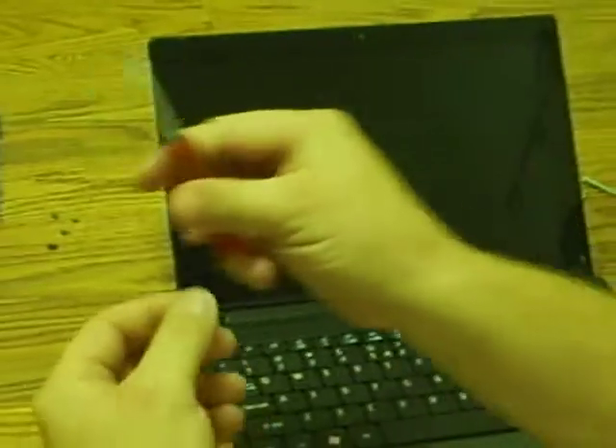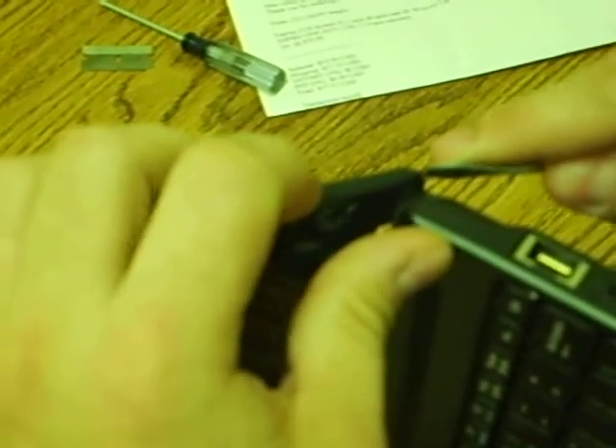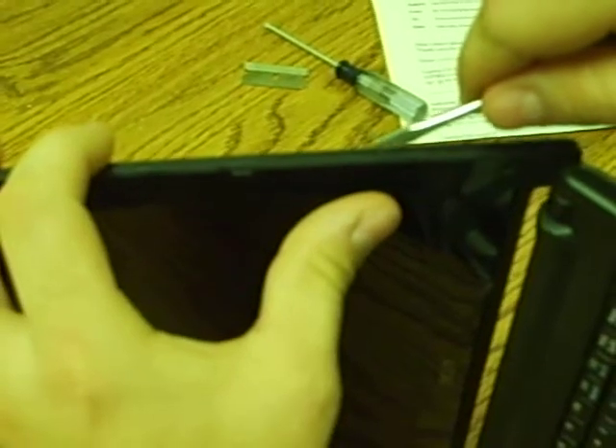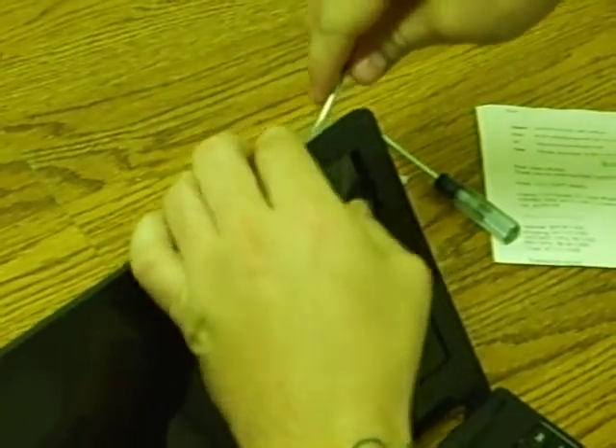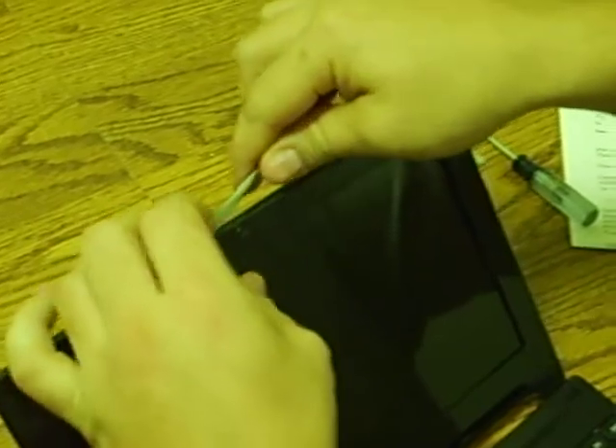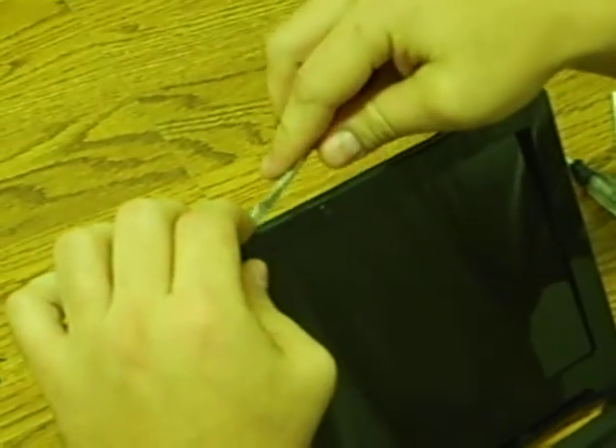There's those two black tape pieces and your two screws. Once you get those screws out, come along with a flat blade and come in the side here. Use the bottom so you don't get too many marks, and just slowly pry up on it. It should come off nice and easy — don't want to force it. Just work it all the way around the edge and have it pop off. Be careful right there by the camera — don't want to scratch the camera lens or damage the camera.